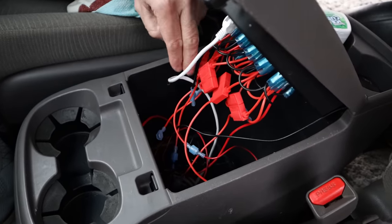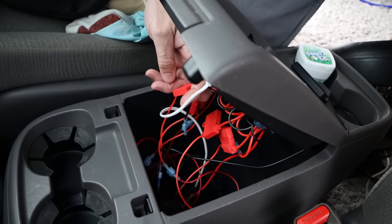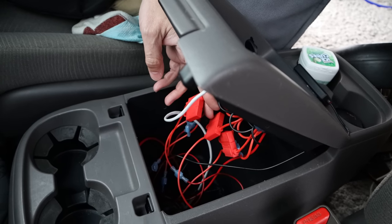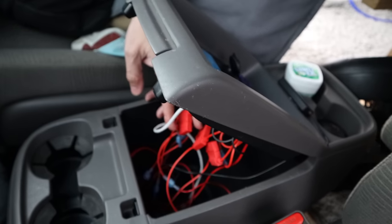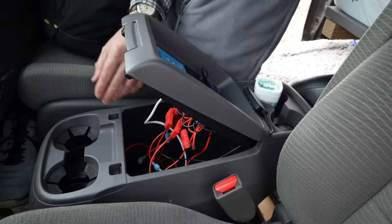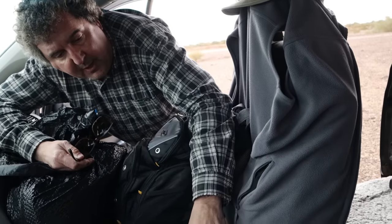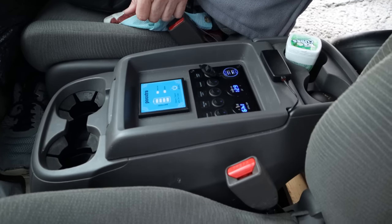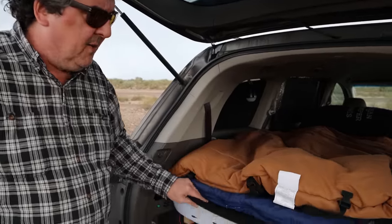This is the remote panel for the inverter — a network cable runs down to the inverter on the floor to turn it on and off. Each one of these switches is fused; nothing I'm running is over 15 amps. The main power comes in here off a circuit breaker at the battery and is distributed through the fuses directly through the switches — there are no relays to run any of the accessories, except the roof light, which pulls enough current that it did need to be put on a relay down below the floor.